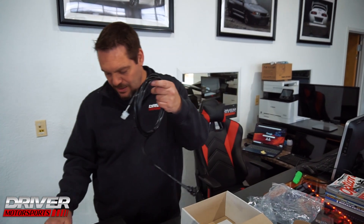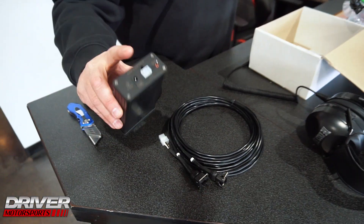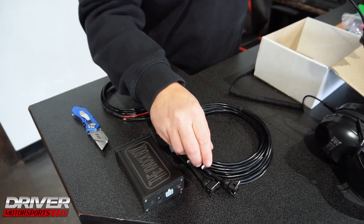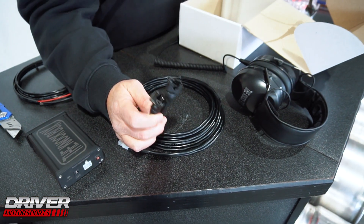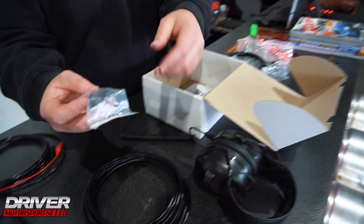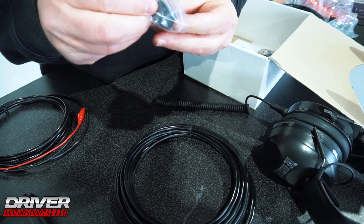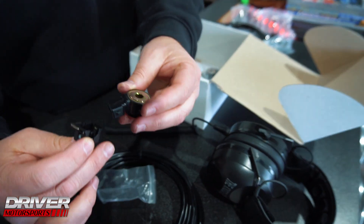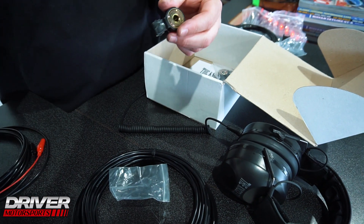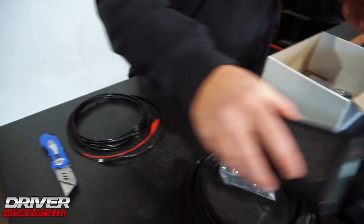So what we got here is the ears themselves — the headset — and then the knock box, which is obviously where some of the stuff plugs into. And then this right here goes onto the knock sensor. You put it directly on the knock sensor, and it comes with its own knock sensors. Attached to this, and then you probably just get power to it and you're listening.